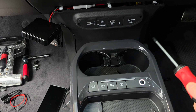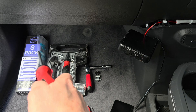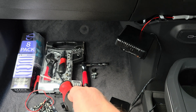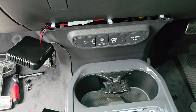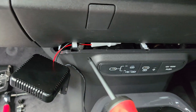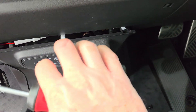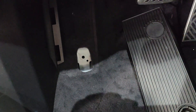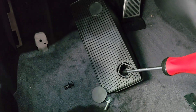To begin with, you obviously need to access behind this panel. With my trusty trim removal kit — available on Amazon for about $10 or from local hardware stores for about $20 — I found this panel is actually clipped in. You can see the white clips: one there, one further down, one in the middle, and one on each side. It pulls forward, but before you do that you need to remove the footrest.